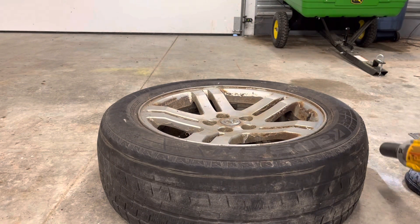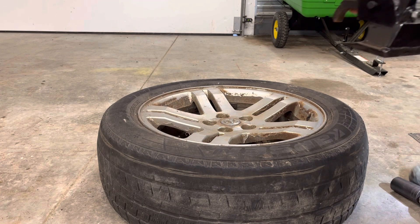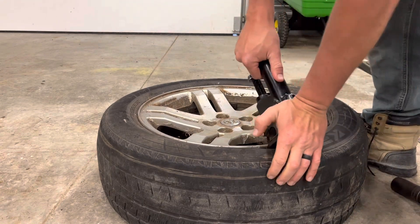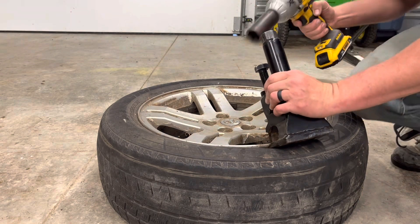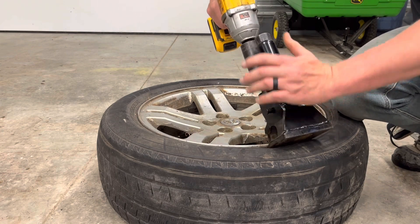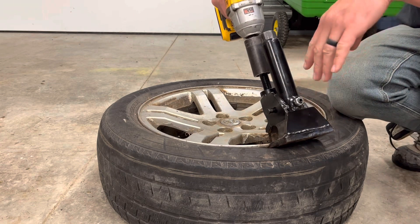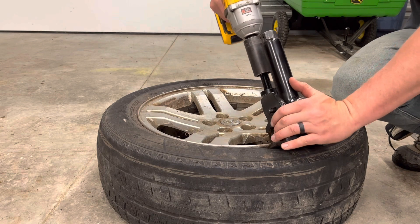Alright, so I got a fresh wheel from my scrap pile on the back there. I have not touched this with a hammer or anything like that — I just pulled the valve stem off not 30 seconds ago. You kind of sink it in like that — it's a 30 millimeter socket on an impact gun. I wouldn't recommend doing this on your nice American Force rims or your Fuel rims or something like that, but for scrap tires or a big tractor tire it works just fine.